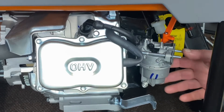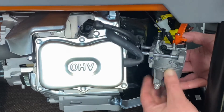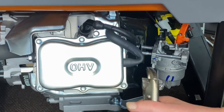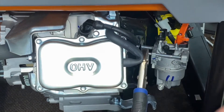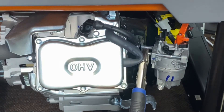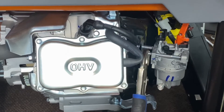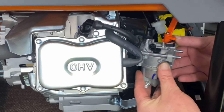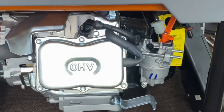This one was a little easier — just pull this back here. Get some vice grips on the back side so you don't narrow up your threads on your end. Lock them down and you're just going to turn them out about three or four turns. That gives you enough space to get your air cleaner back on.